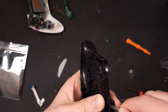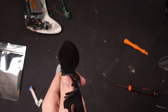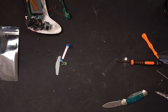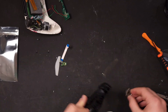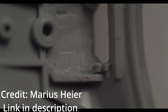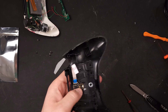For me, I used various tools including a little tiny file and a pocket knife. Be very, very careful when using anything sharp and do not cut towards yourself. In order to get this to fit, you really need to focus on two different things. The most important thing was removing plastic around the USB Micro B port in order to allow the USB-C port to fit in. You also might have to remove some plastic around and below where the board goes. In that case, just use a flat head screwdriver to scrape away excess plastic. After a couple minutes of trying, it finally slots back in, and all you have to do is put one singular screw in and you're basically done.